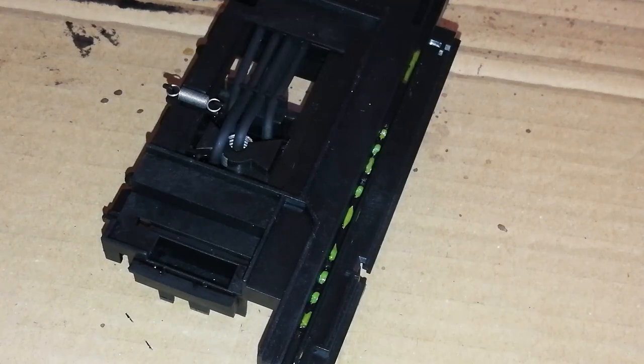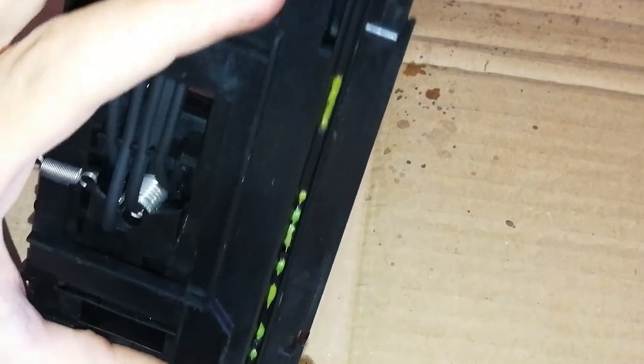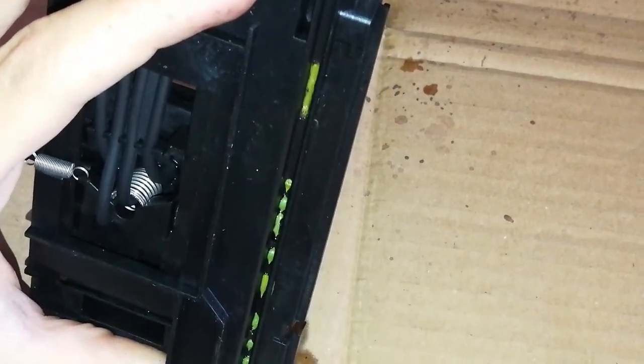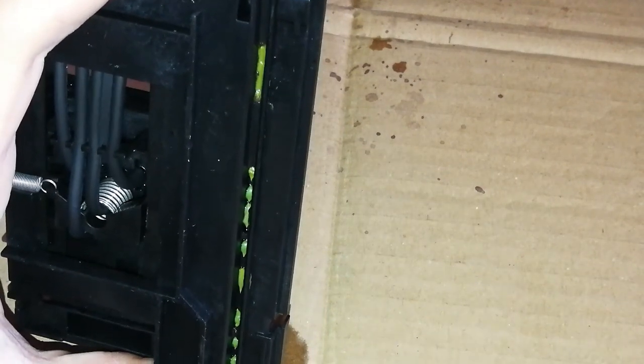So let me try something. First I want to spray some glass cleaner inside the track and onto a paper towel. Then I will take a flat blade screwdriver and use it to clean every sort of grease, grime, and ink buildup that is on this track — only the lower part, because we're working on that side because we want to raise this side of the unit.